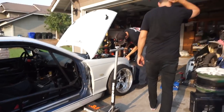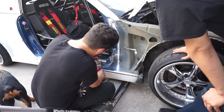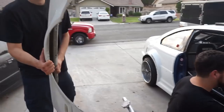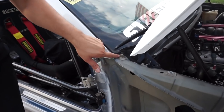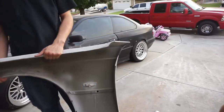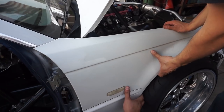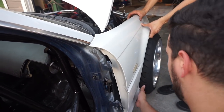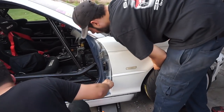Now that we have the door off, we really want to drive it. This is a sealant that BMW uses, but the back mount on the fender was running into it, so we couldn't slide the fender back hard enough. So now we're going to try to throw it on and see if we can get the alignment right. The idea really here is to secure the fender as good as we can get it, as close to the factory as possible, and then cut it up — so it's mounted all legit, not rattling, not shaking. Then we can start worrying about getting it cut for the fitment.